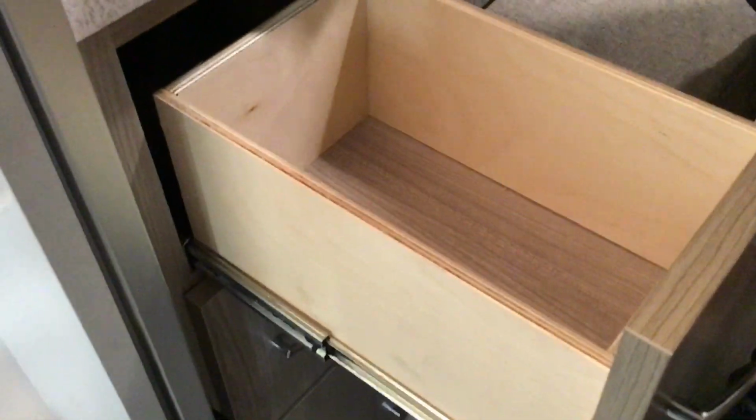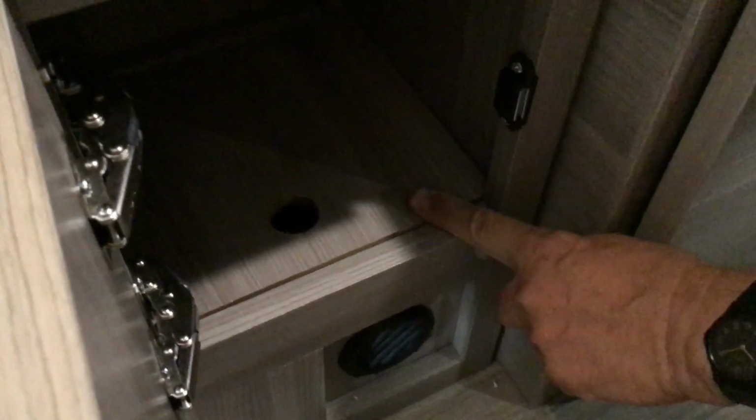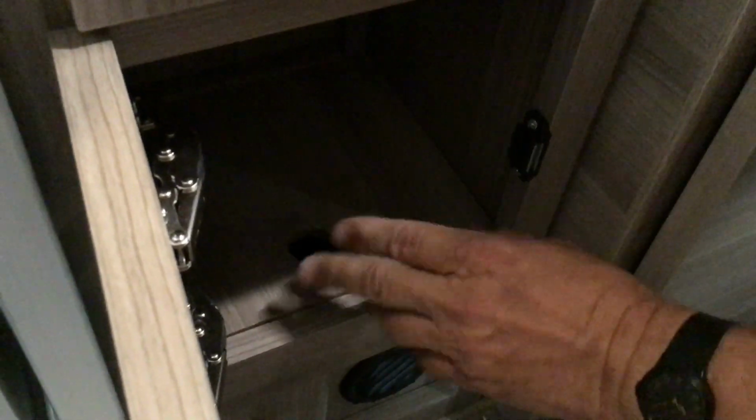And now we have another little cabinet, adjustable shelves. So, you are supposed to be travelling light, so you haven't got much choice. But sock drawers or whatever. Then under here, you have another one. But inside this cabinet, pause there. So, in the bottom cabinet, this is the access hatch. This is basically for a technician or somebody to get in. There's a valve for the water drain for the fresh tank, the winterizing kit hookup, and the low point drains are in there.